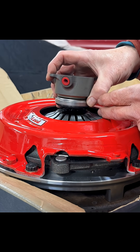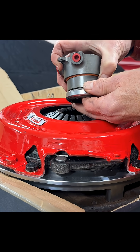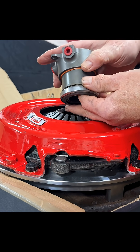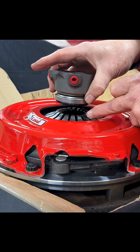If the air gap is too big, you do have a risk of actually pushing the cylinder all the way out and releasing fluid all over your clutch. So you need to make sure you get that good balance and set the air gap correctly.